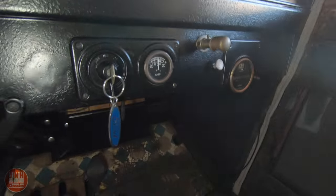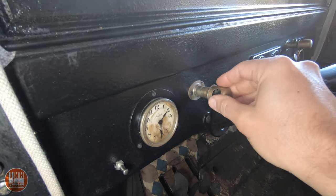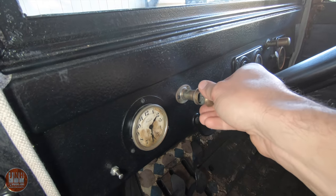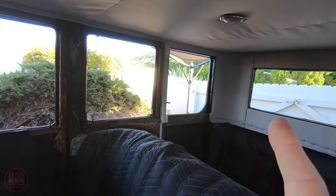I've been trying to get these dash lights to work, but they're six-volt bulbs — the whole car is six volt. These particular bulbs have two contact points on them and I haven't been able to find them even online, so I'm still working on that. I was able to find a correct six-volt bulb for the dome light, so I've ordered that and it should work soon.